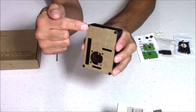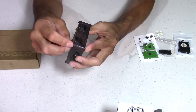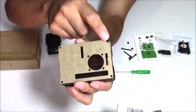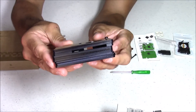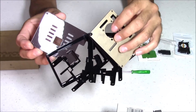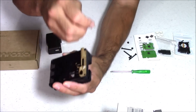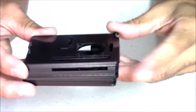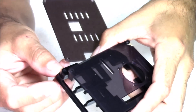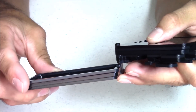I'm going to start by removing just three screws on the top of the case. Each screw is secured with a small nut and should only be hand-tight. If not, you can use a small pair of pliers to hold the nut. I only removed three screws so the case would somewhat stay together — with nine different layers, if you take all the screws off it becomes kind of a puzzle. I found it a lot easier to leave one screw in place to keep all the pieces organized. You can remove the protective film anytime — it just keeps the case from scratching.